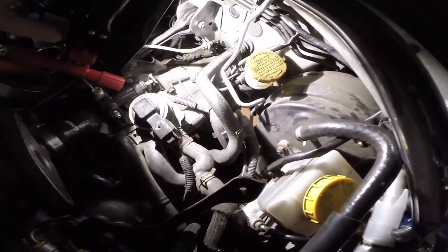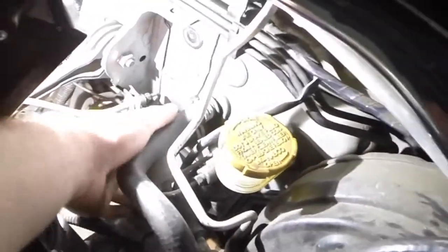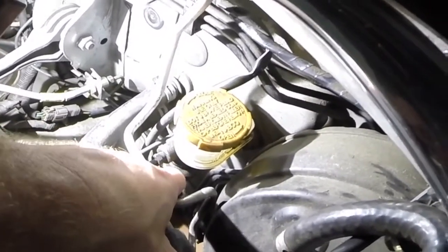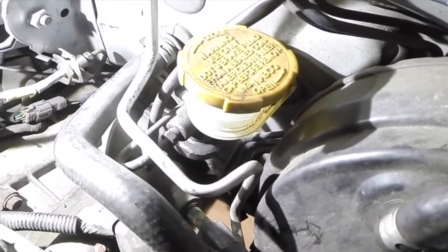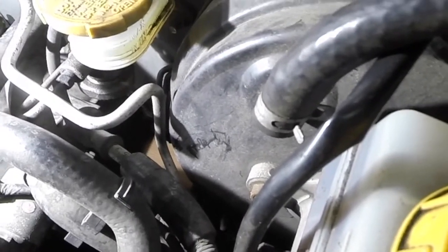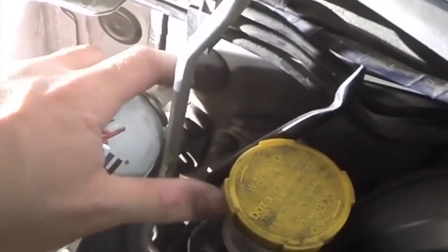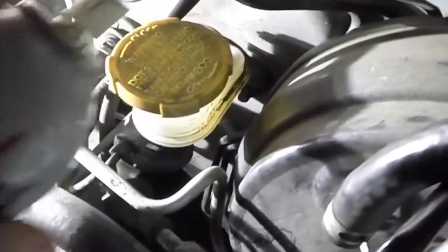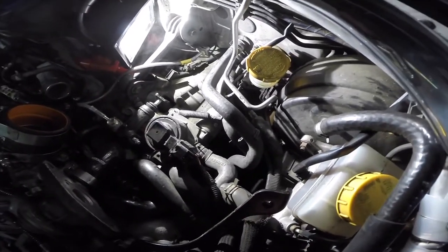We just removed the intercooler and now we can see our clutch master cylinder right here. If you look closely right at the bottom you can kind of see some condensation or some type of oil seeping out the bottom, which tells me that it's allowing air into the system but it's definitely wet. There's definitely some type of fluid coming out the bottom so there's a bad seal there — definitely need to replace this. Just to be safe I'm gonna spray the little nuts here just in case they're pretty corroded on. I doubt this has ever been replaced.